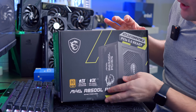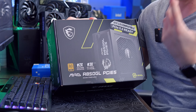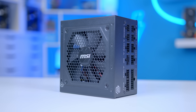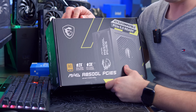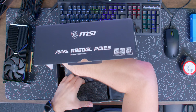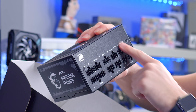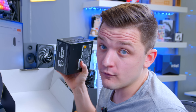Thankfully, a couple of brands have caught up with this. One example is MSI, who evidently got so fed up that no one was making power supplies for their graphics cards that they made their own. This is 850 watts — still more than you actually need for the 4070 Super — and we'd recommend looking at a 700-watt unit or above. It can often be found for sub $100, comes with the 12-pin power cable and 80 Plus Gold certification out of the box. It's also a compact ATX3 unit and won't cause any compatibility issues with cases we've recommended.